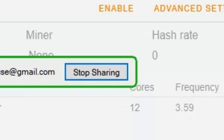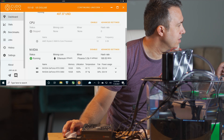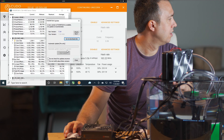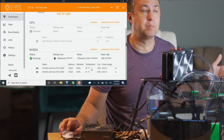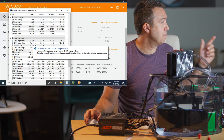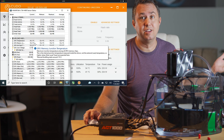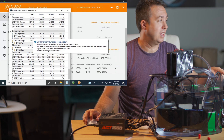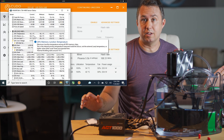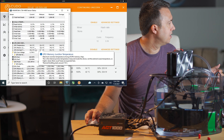Graphics card's running. Computer's running. I can remote into this computer from my Mac to control it. So it looks like what we have here is two 3080s running — 38 and 33 degrees. That one's water cooled. Looking at hardware info: 188 hash rate total, so these graphics cards are hashing at 90-something mega hash each. The GPU temperature is 34 degrees Celsius and the memory junction, which I normally hover around 100 with air-cooled cards, is at 72 — which is glorious. Even my water cooled 3080 has a memory junction temperature of 92 degrees, which is normally awesome. This full immersion card is at 74 degrees.